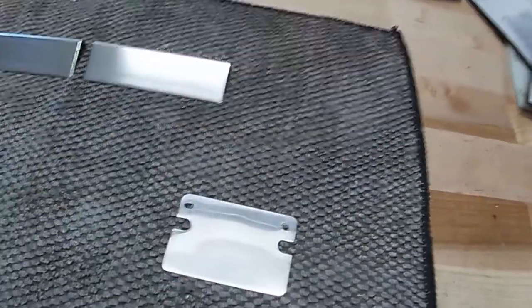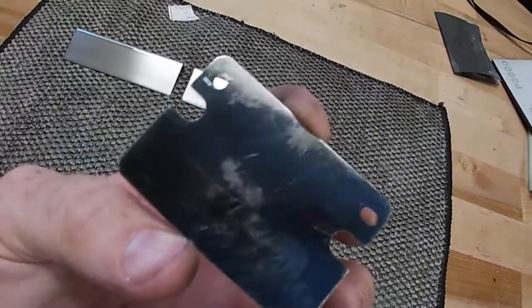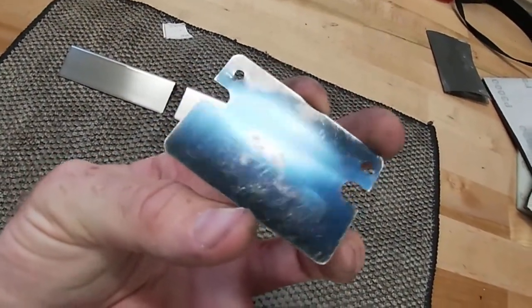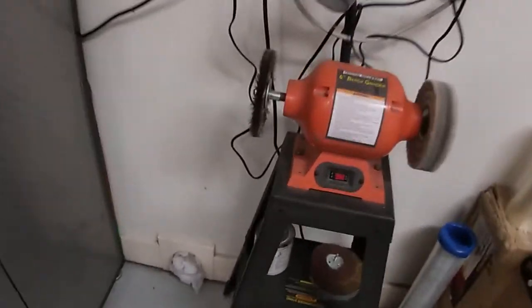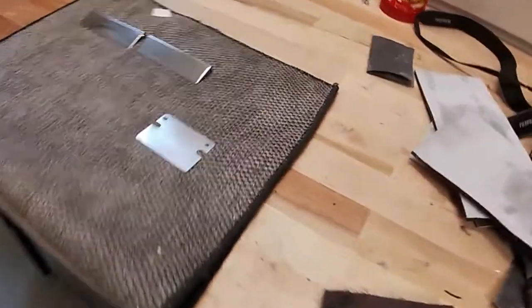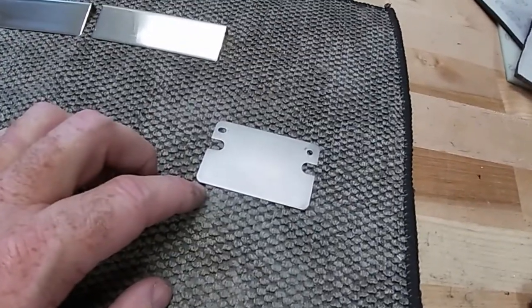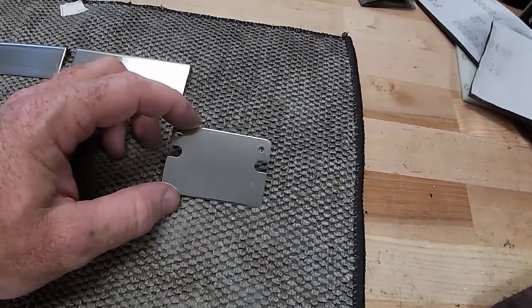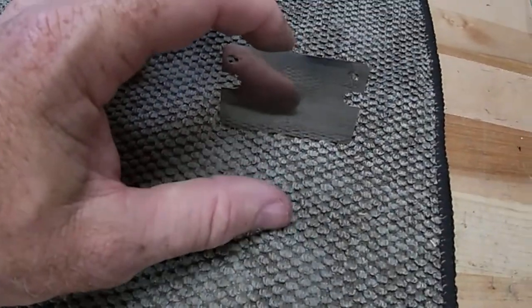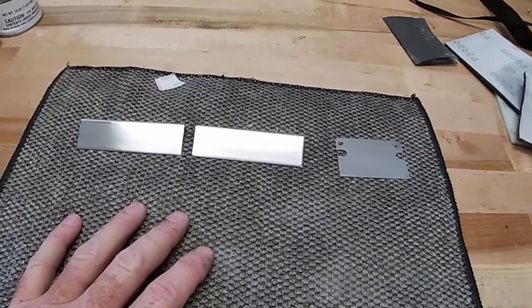On the ramp flaps — these things are like blue steel. Most of the ones I've done are corroded or have a little rust on them. You can see how bad it was on the back — I already took the rust off. If it's a pretty good piece of metal, I'll try and save it. The first step is taking all the blue off and the rust, so you just use a wire wheel and run through it. Then I do the same thing — I started with 320 grit and worked my way all the way up to 5000. It's a nice finish. I don't really care for the blue anyway, so I'll keep it like this and put a little clear coat on it for protection. Once again, you can see it's pretty reflective — not really a mirror, but pretty reflective. I'll be able to use that piece over. I'll get these pieces finished up and put back on the ramp, then move on to the next part.